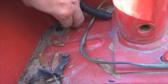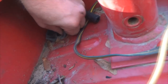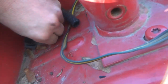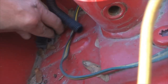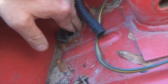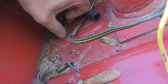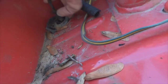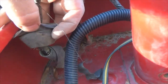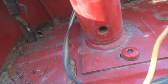Okay, now right here you've got a rubber grommet, and this is inside the tub right next to the roll bar. You take a rubber grommet and get your screwdriver — I need both hands to do it. But anyway, you get your screwdriver, wedge it down the side there, and you can push that grommet in enough to wedge it up above the sheet metal and pull that whole thing out. You can see right there it had that lip that sits inside the harness.